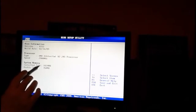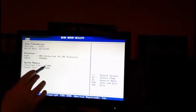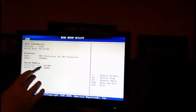if I go to System Information, this is actually going to show me, if you remember we installed the 2 memory chips, this is another way you can check if the memory chips are working properly. You remember each one of those memory chips was 512 megabytes? Well, there's 2 of those, so 512 times 2 is 1024. This is telling me that both memory chips are working correctly. The installed size is here. This is a usable size, which is 768 megabytes. I don't get the full benefit of using all of it because the memory is used for some other things as well, so it's going to take some of that memory down.